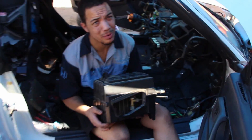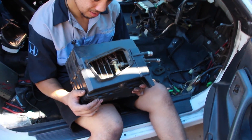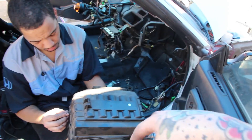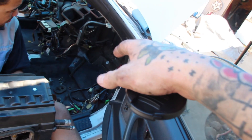We ended up putting the blower motor back in too — I want to be able to have heat if I need it, just in case. We got this AC assembly out and we're just going to be taking the guts out of it because that's all for the AC stuff, and I don't plan on putting AC back in. That's weight reduction, and it's going to clear up some space. The box is going to stay just so I can have heat, but it's going to look better anyway.